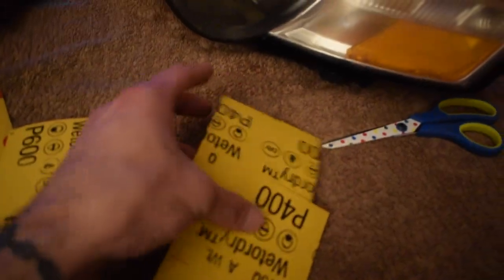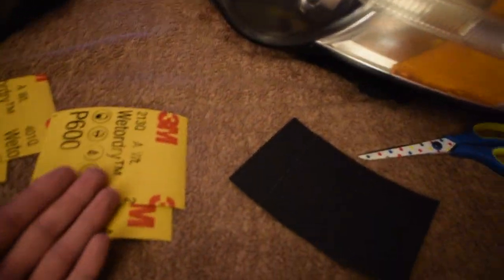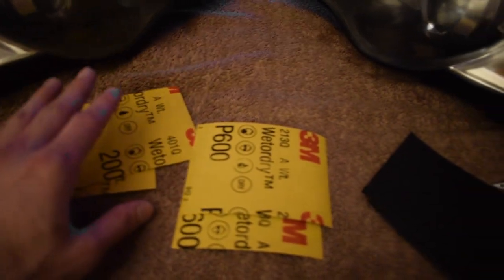So we're gonna clear these, but the process is we're gonna wet sand them. So we have sandpaper here. We have 400, 600, and then 2000 grit sandpaper. That's what we're gonna be using. You start with the 400, you wet sand, and when you're done doing that, you use the 600, then you go to the 2000. The idea is to wet sand it and take off basically the clear